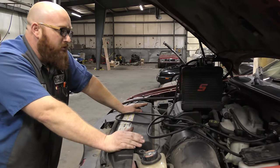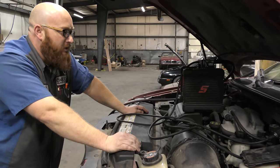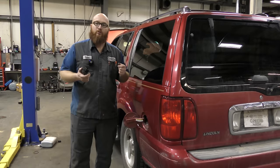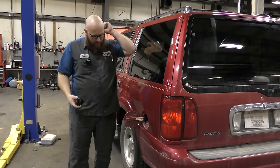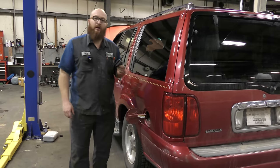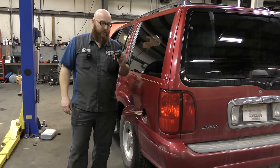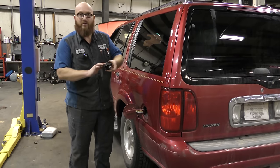Some guys like to use nitrogen to put into the system because it's not flammable. I've never seen an issue just using shop air — this uses shop air from the factory. So you get the code, the check engine light that says minor or small EVAP leak. Sometimes it will actually have a light on some vehicles for gas cap. This gas cap has to seal those vapors. The EVAP system can't contain the vapors if your gas cap leaks them all out. Your computer will know when that happens. Typically, it's a gas cap if it's the small leak.